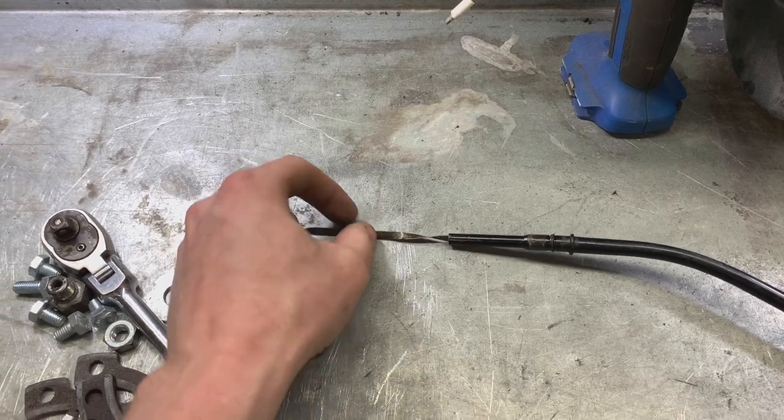So if I cut off this dipstick to the right height, then I can put it down in the block and pour oil in it. And I think I'm going to probably do 7 quarts, mainly because I've got a remote mount oil filter, so that's going to add probably two foot long half inch hoses, and then the line going up to the turbo. So I'm probably going to want an extra quart of oil in there anyway. And I'll do that, put my dipstick in, mark where the oil sits, and then cut off about 1/2 inch lower than that, just so I'll know where the add line is. It's not perfect, but it'll work perfectly fine as long as I keep checking on the oil and I don't have any leaks. So a lot of extra work, but at least now I can get in there and see where everything needs to be, because with the turbo and manifolds, bumpers and all that stuff there, I couldn't see a thing.